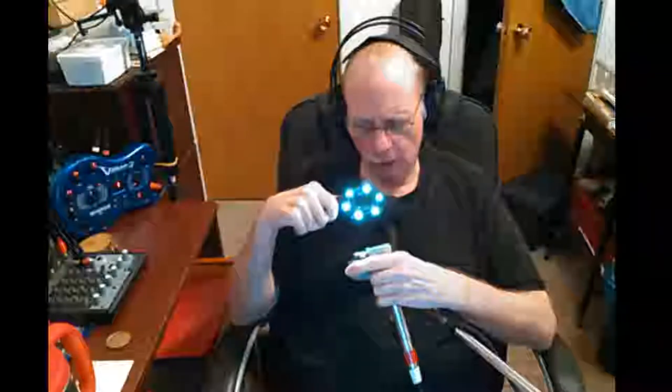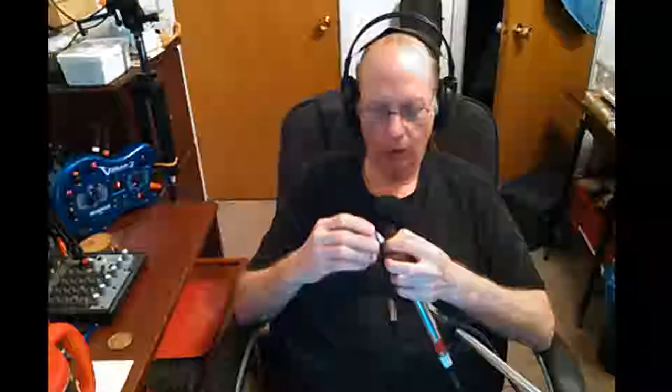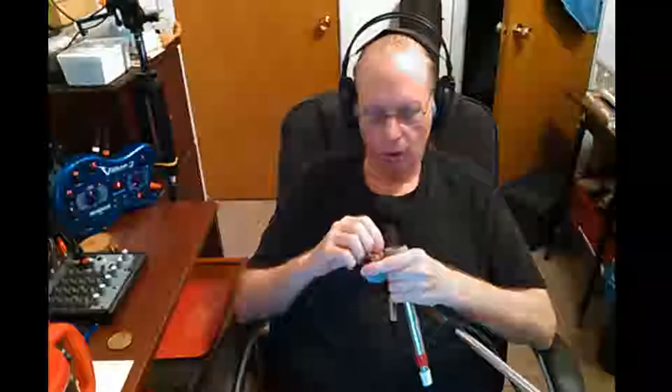So I'm guessing that the element's actually bad in this thing. The solders look perfect. The wiring looks good, you know. That's why I'm wiggling it around with it open. The wires shouldn't ever get any stress on them unless this had come loose, the connector, your male connector. You think it's female because it's in a hole, but those are male, and these are female here.